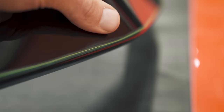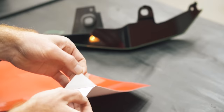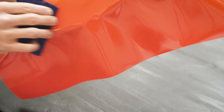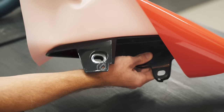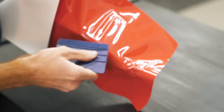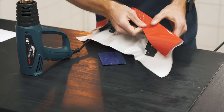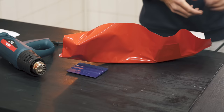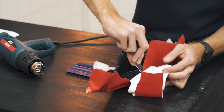I'm going to lay a piece of cutting tape along the body line with a few centimeters of tape hanging out each end for me to use later. Then we'll stick the vinyl on the biggest and flattest part first. This section is easy, but now we need to get it around the corner towards the bolt hole. This is where heat will make the vinyl easier to stretch. Try and work the vinyl in the direction it needs to go while creating as little bunching and creasing as possible. Some creasing can be worked out with the squeegee, but there is always a limit. Making relief cuts to the excess vinyl or trimming it to match the shape of the panel can make life easier.